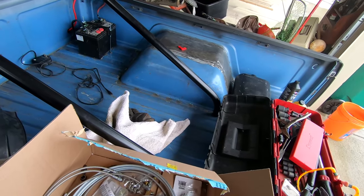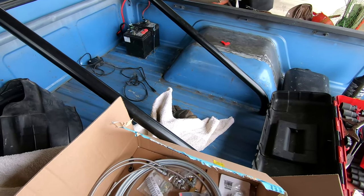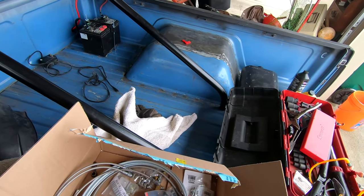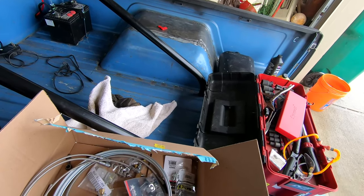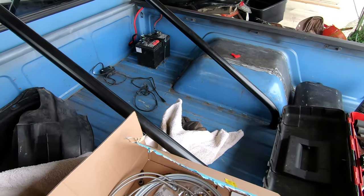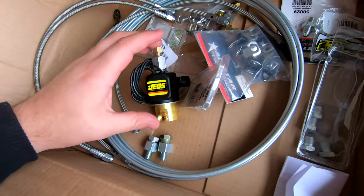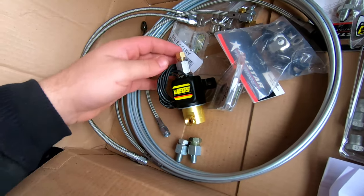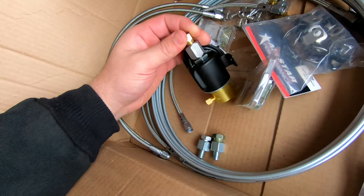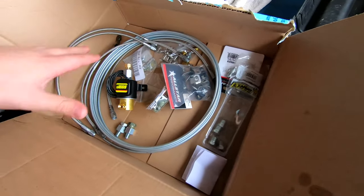With a big-tire car that's more important so you can lay down a nice patch up to the starting line if you've got slicks on. If you have street tires you don't want to do a big burnout through the starting line, but with slicks you do your burnout and lay your patch of rubber through the start line so you've got a nice surface. It's good to be able to do a burnout but also have roll control — that's basically what we're doing with this solenoid.